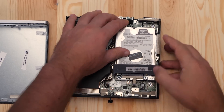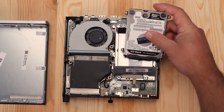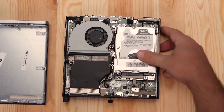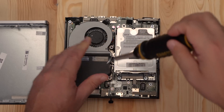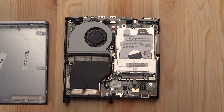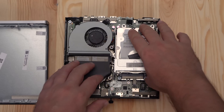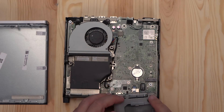On the bottom of the system, we have a hard drive — a Western Digital 500 GB drive, which isn't even particularly large given how easy it is to get a half-terabyte SSD inexpensively these days. This also uses the older HP retention model — there's a hard latch you have to unlatch and then push the drive out, and there are little pegs you need to align with the metal assembly. It's a real pain to service. Contrasting that to HP EliteDesk models, you get a lot more tool-less service as you move up in the HP line. You also have to undo two screws to get the entire drive assembly out — a lot of Dell and Lenovo units have gone tool-less these days, so this feels really old, even though this was produced in Q4 of 2019.